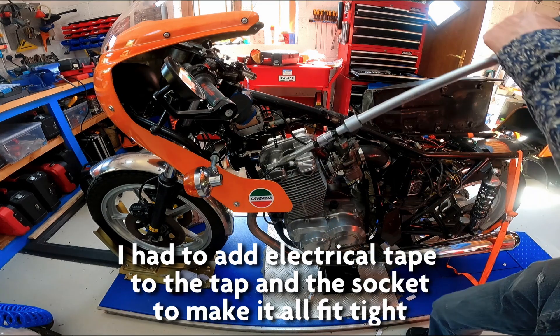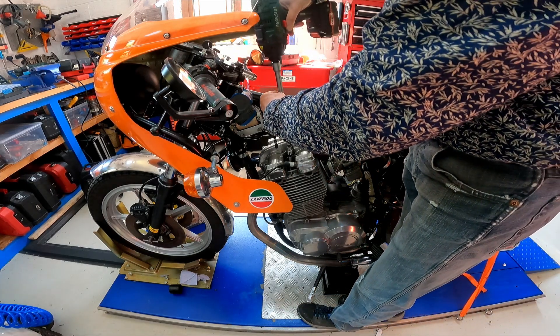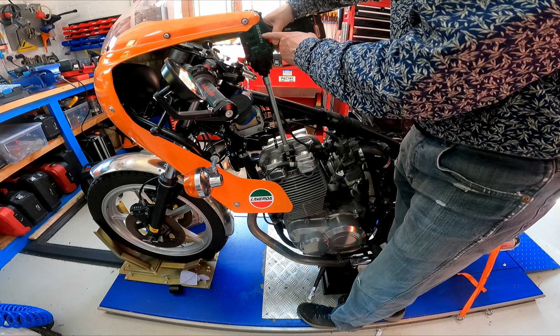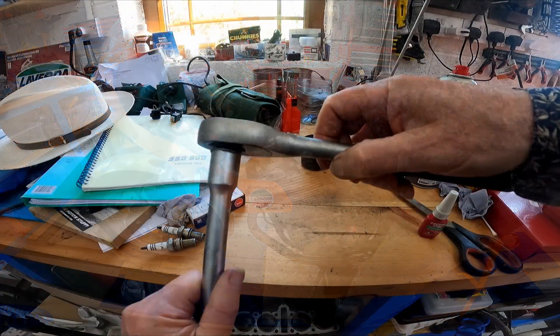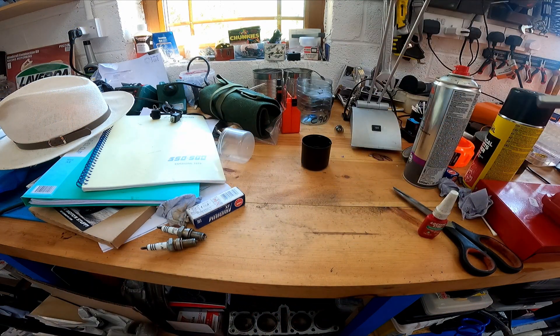Before doing this, make sure the piston is at the bottom of the stroke — you don't want to drill through the top of the piston. Get it in position, visually line it up, hold it straight, and run the drive. It was quite nerve-racking but I got it done. I had tried with a ratchet but couldn't get the downward force, so that's why I used the impact driver.